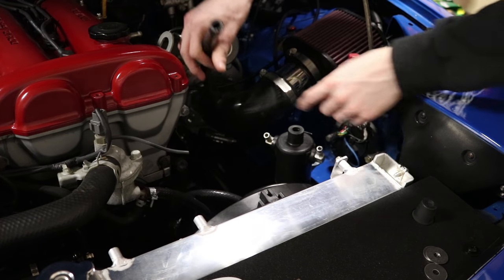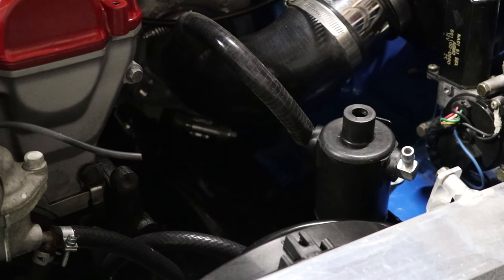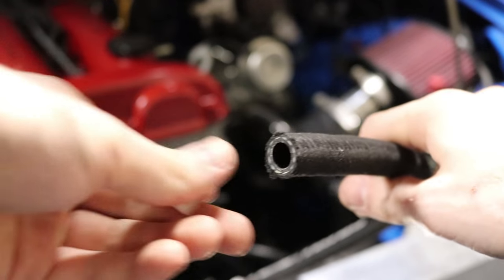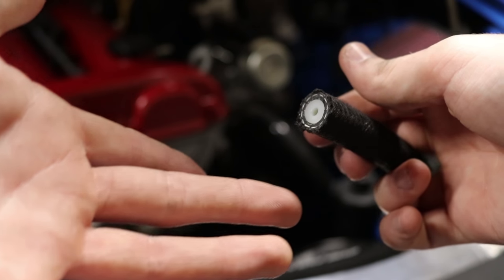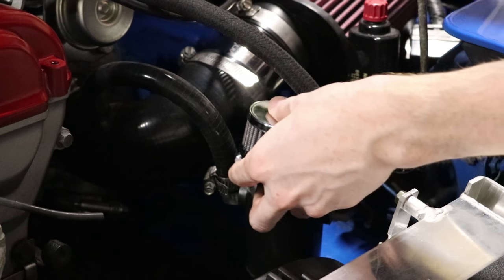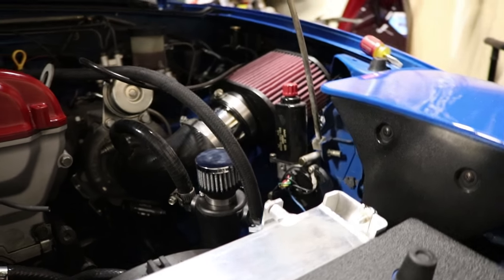And there we are. So this little tube that goes into the intake connects on one side — it works better when it's on the right side. I'm going to go ahead and tighten the bolt now. That's pretty dang sturdy. So glad I used the real metal. Now we have to connect the port on the valve cover to the other thing. Go ahead and connect one side to this. Now on one end of this hose we are going to put this little restrictor in — I'll be honest I don't exactly know what that's for but I'm guessing it's to restrict things. Hose clamp — that goes on, the full thing goes over the socket, push down as hard as you can, tighten. I went ahead and added a hose clamp on that hose because it was a little loose. So that's installed.